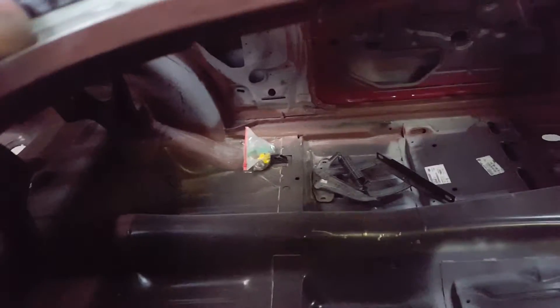So what I'm doing right here is a buildup. I'm trying to emulate this line right here. So this is a new roof and this is a new quarter panel — they got welded right here. My job is to do the body work, make it look like nothing happened. I got to get this body line right here, so I got to do a little bit of buildup so I can get a nice straight line.